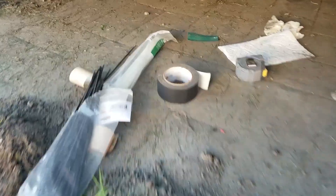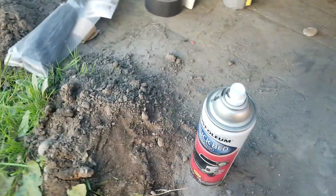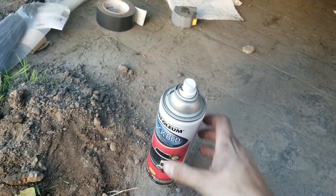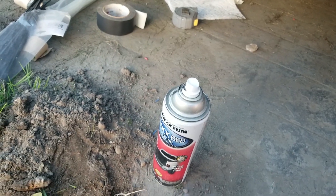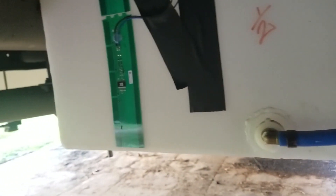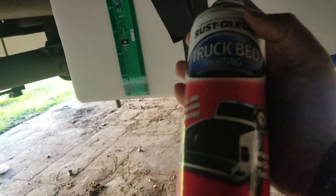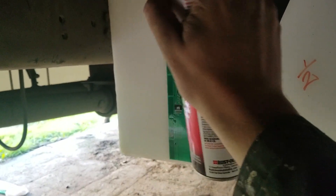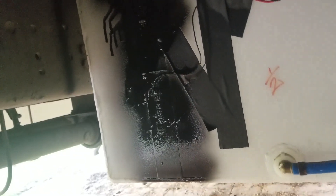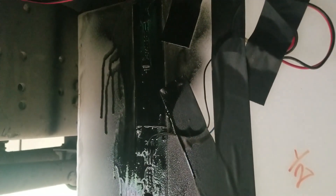The final step in this installation is to coat the senders with a protective coating. I've got truck bed liner, but you could also use undercoating. The instructions say that once everything's mounted, you can spray a coat of this stuff right over the top to protect it from debris and dirt. Here's my fresh water tank — this is kind of temporarily holding the wires in place; I'll figure out a better solution later. I'm all done, so to protect it I'm using truck bed liner — just gonna give it a spray. That should be plenty. Let that dry and it's good.